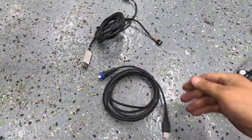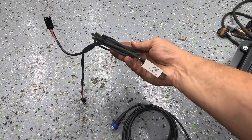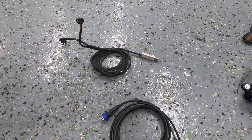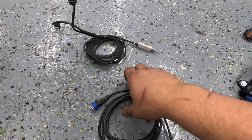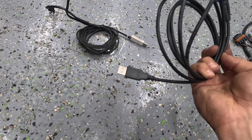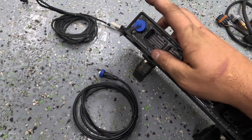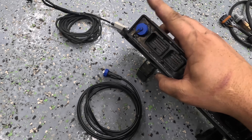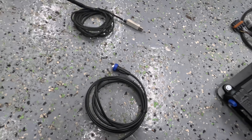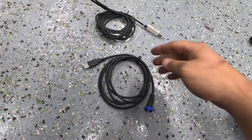The last of the hardware changes: if you're a laptop guy like me, I had a Current Performance CAN-to-USB cable as the interface to link my PC to the Terminator ECU. When you run the Dominator, there is a mini USB to standard USB adapter that plugs directly into the ECU in the blue port. From what I've seen over the years, you've got to be very careful with this — it's pretty easy to bend or break the connector. I have a hardwired USB port on my dash, so I'll just hook this up once and never have to touch it again.